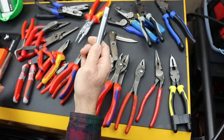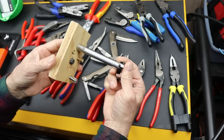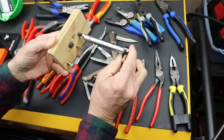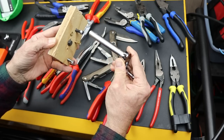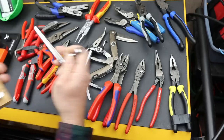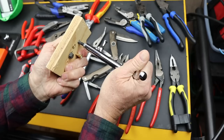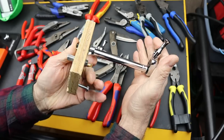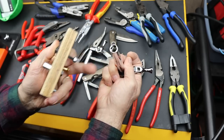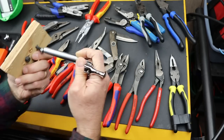Low profile, got into small places, you were able to work on the terminals without banging into stuff. The difference, however — if you notice where I've got this bolt — those battery retention hooks generally require a fairly long spin of the nut. But the VIM actually fits all the way down because it's fairly deeply recessed, whereas the Snap-on is not, it's more conventional, so it hits pretty quick. This one doesn't quite have the reach, but it does have the pass-through which you need for that threaded rod that sticks up.